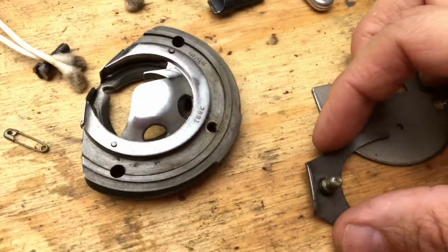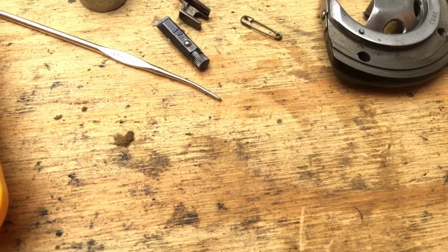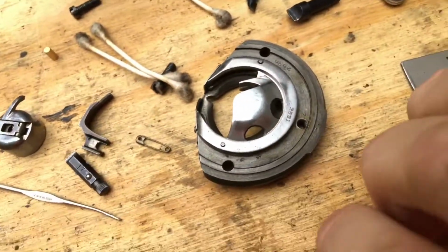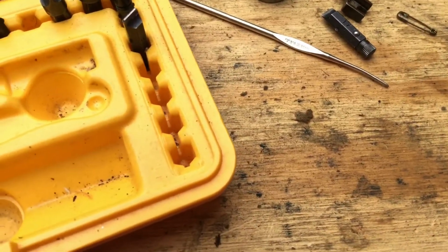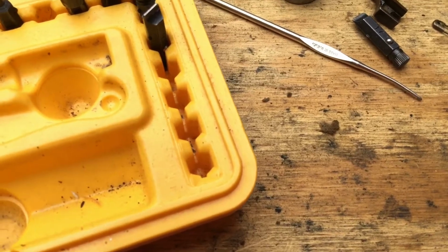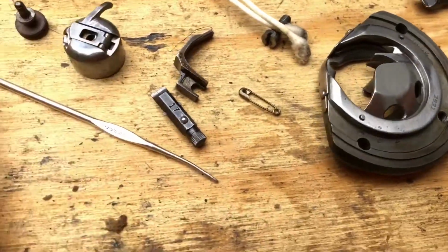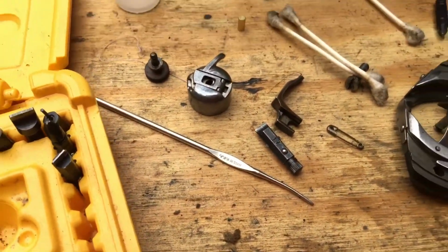And you'll see, I don't know if you saw this, but I put a little drop here. When I'm restoring a machine, this screw may not have been removed for, who knows, 75 years. It might have gotten one servicing. Because it was stiff, when I go back, I'm just going to put one tiny little drop of oil on it. Again, that's not normal maintenance. That's a restoration thing, for those of you who might be wondering, God, do I have to do all this oiling?